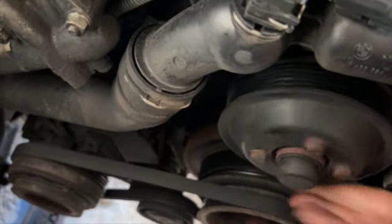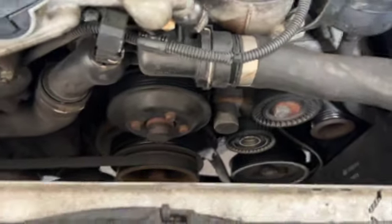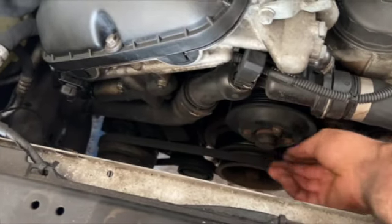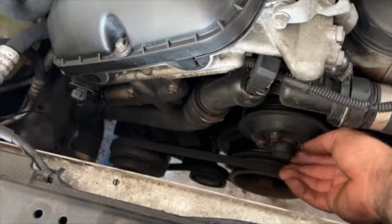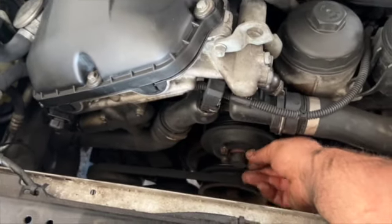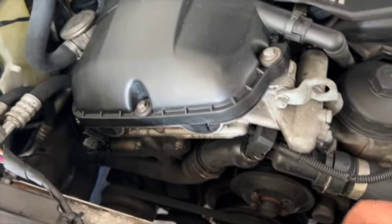That's the noise we're looking at — it's the water pump. Now what I would advise is, with the belt still on and if you suspect the water pump, just crack the bolts off with the belt on. That's the only way you're going to get enough tension to actually do it.